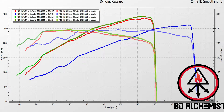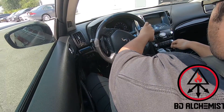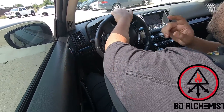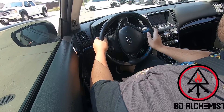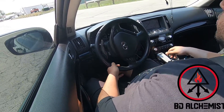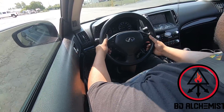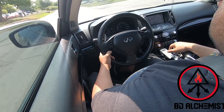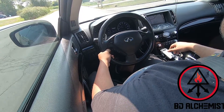Just adding timing increased it to like 290 horsepower. We tried adding a little more timing but it only made one more horsepower — wasn't really worth it to keep high timing like that. This car is an automatic, so automatics are expected to make slightly less horsepower. The car feels good, everything is smooth. The customer wasn't really looking for power — it was more about running safe. He added these intakes and exhaust which can make your car run leaner. Cleaning out the MAF and long-term trims helped address the low-throttle issues.